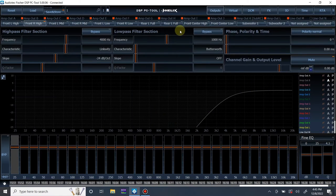Today, I am going to show you how we do OEM integration in a relatively simple vehicle. We're going to use the built-in input RTA. I'm going to show you how to use that, how to do summing, how we set input gains, and how we do input mixing. And I am going to show you how to actually tune it a little bit using the built-in RTA.